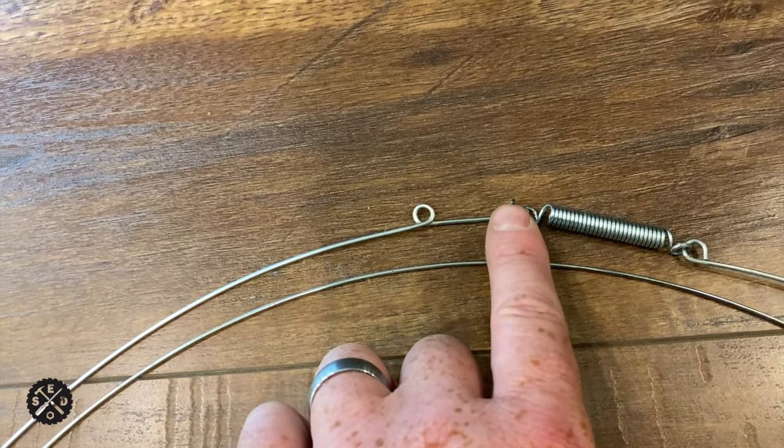Now working from the bottom up, this part here — you have to pull this seal out over and then kind of roll it over this part. The spring is going to go in this slot, so it's the last fold back in here that has to go over that. Keep working your way around. You can tell when it's in there correctly because it pretty much sits flat without even having the spring in there. Make sure that's seated all the way around. For the front spring, it has a spot where it needs to go straight down — there's a little relief in the bottom for where it goes. Get it started in there, then once you're most of the way in with the spring tool on, just squeeze it for tension release. Make sure you're lined up straight down in that relief — it doesn't have to be perfect as long as it's in that little relief cut in there.